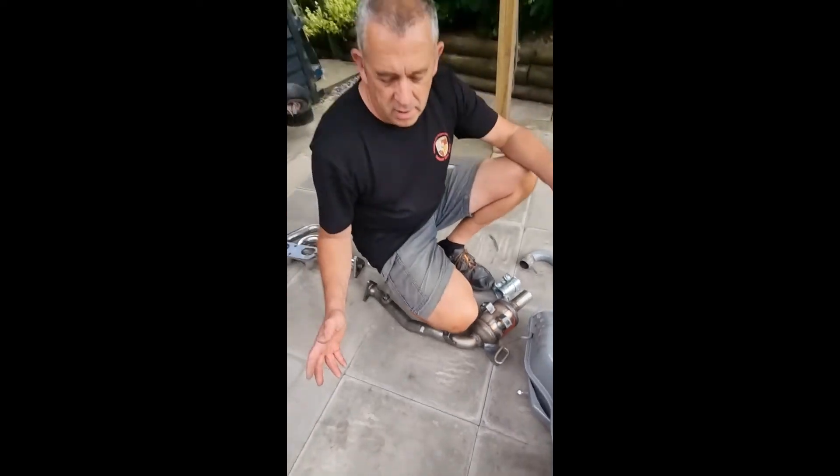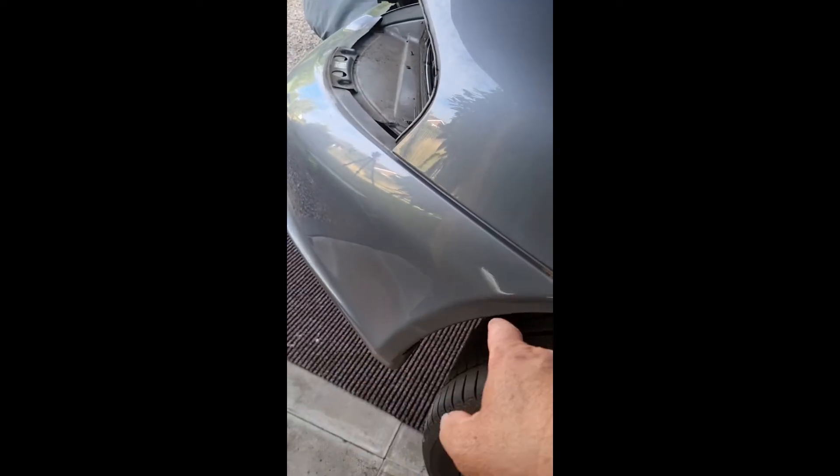Now we've seen the system off the car, we'll get the car up and have a look underneath. We've taken all the fittings off the exhaust and now we need to remove the rear bumper to extract the rear silencer. Up under the arch, there's a small vertical screw with a Phillips head which needs to be removed — these are sometimes quite tight. Same on the other side. Underneath, you also have screws across the bottom edge.